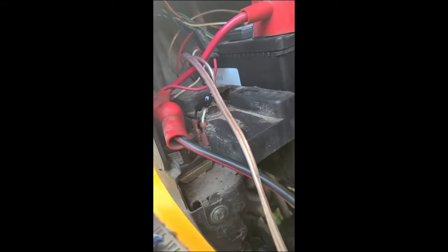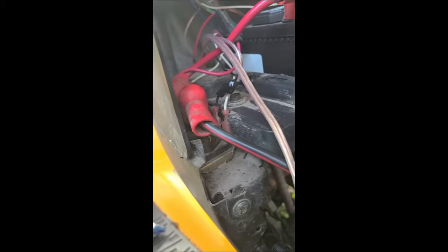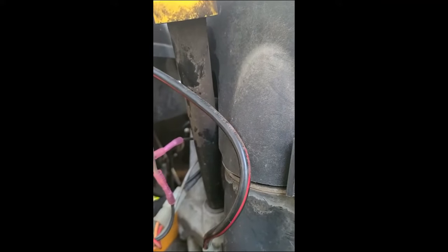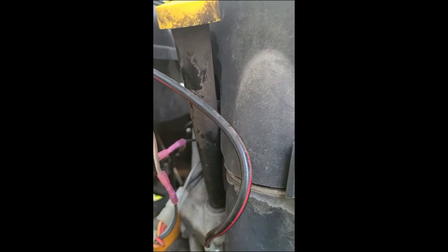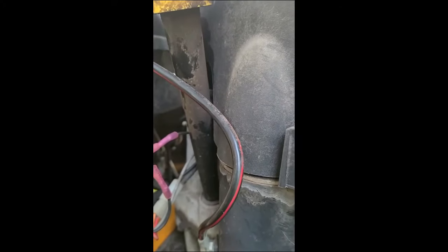For years I've struggled with these switches just like many of you, and I started doing the 'keep it simple stupid' thing. I came back to the motor and looked at the wires coming off it, and said: there's only a couple of wires coming off this motor — why are we messing with all the wires in the back? At the end of the day the motor would die if a safety switch was triggered, regardless of whether it was open or closed. What makes this motor die is the ground wire going to those coils — in this case it's the black wire right here.